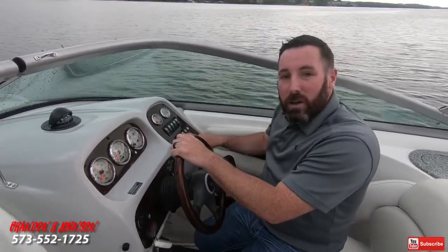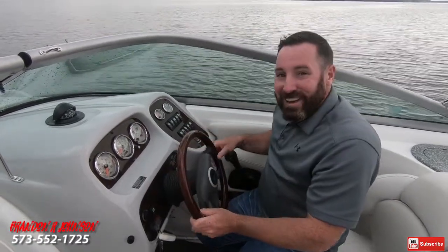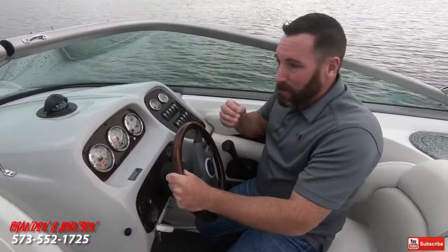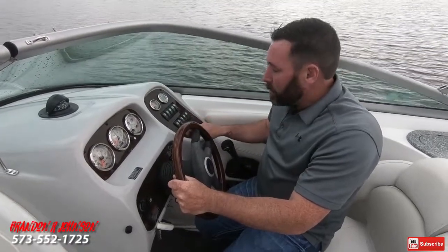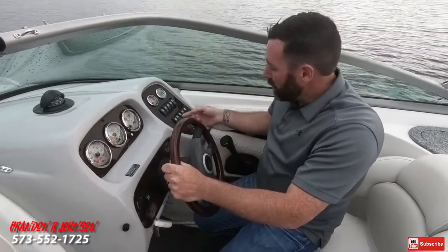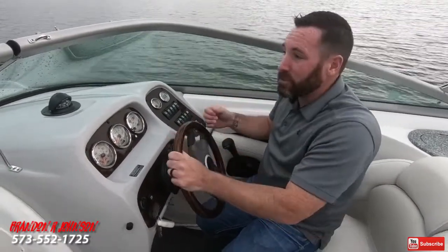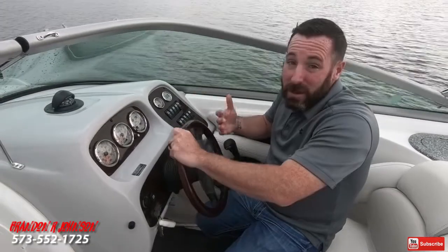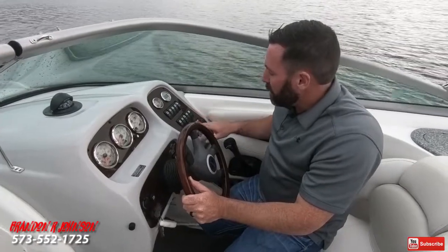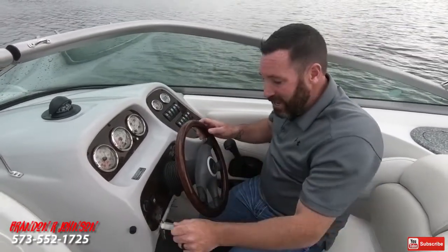Captain's call exhaust — very important to point this out. See how good that baby sounds. What you're doing here is choosing how your boat pumps out the water it uses to keep the engine cool, and combined with that is the exhaust. If we're running hard — 2500 RPM or above — that's really putting a lot of water pressure through there. What makes that sound change is flappers in there, and if you hit this button you're moving those flappers. Maybe not the first time or the tenth time, but eventually you'll break that. So only select this at idle speed. The power engine hatch is right here. There's no wiper but there's a button for one. Accessory is right here. Stereo is on the key — if you're coved out turn the key to the left to the accessory position.